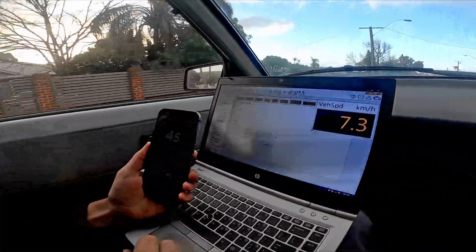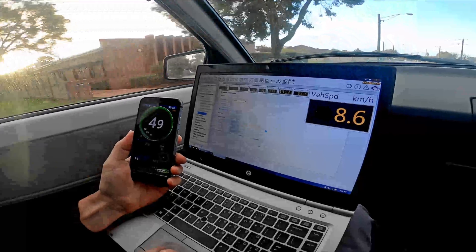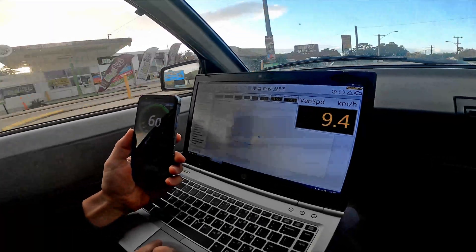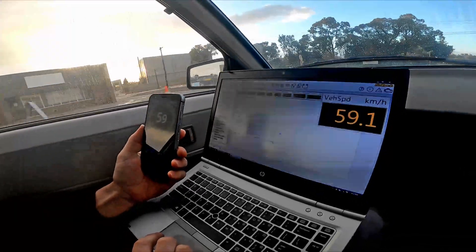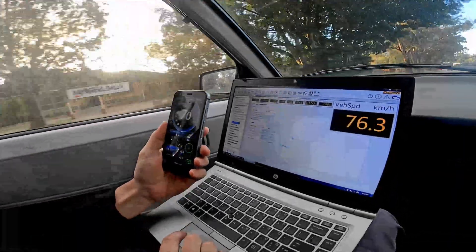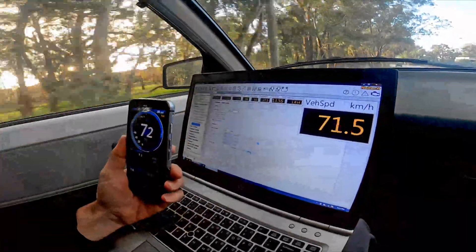Okay, so here we go with calibration — how much speed have we got? About 47 km/h at the moment. Keep going — 55, 59, 61. Wait for it — 60! Calibrating. Alright, we're doing about 60 now, 359 pulses per kilometer. We're just checking again — we can still see it's going up, it's over 73. Nice.